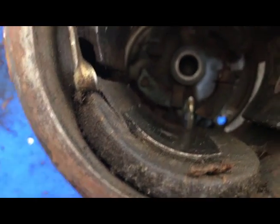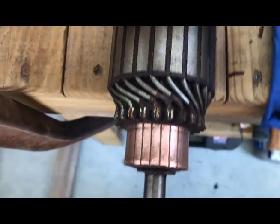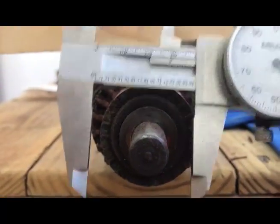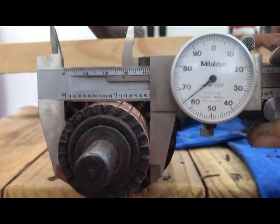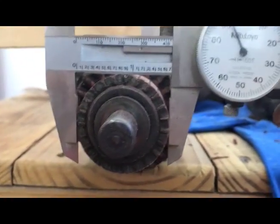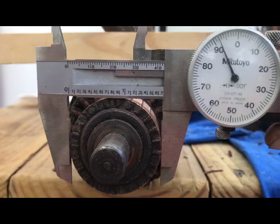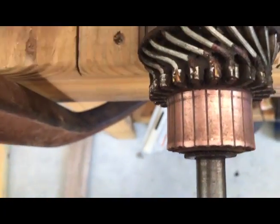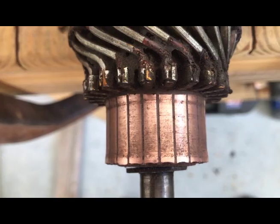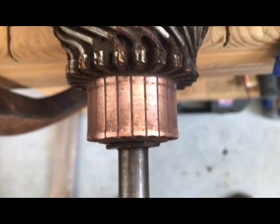I did take my cloth and polish this up a little bit. What's really interesting here — you can see it — in the middle it's one point six six five, and out here at the end, which I've already knocked down a little bit with the cloth, it's almost one point seven, about eight thousandths short. So there's a pretty big difference there. In the back it measures one point six eight-ish, so I'll probably even if I get by with it this time, I'm going to need a starter.